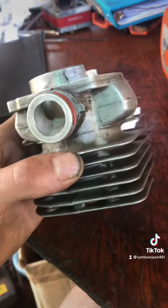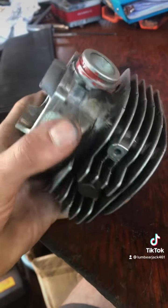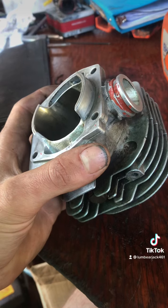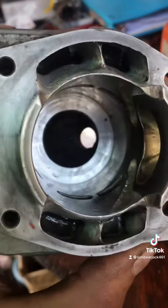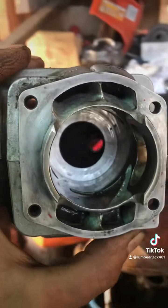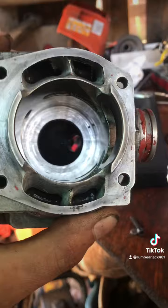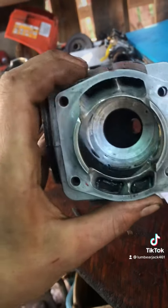Okay guys, here it is. My phone ran out of battery last time, so I don't know if I got all the footage. I ended up taking almost 55 thousandths, something like that, out of the squish band. I'd say that's pretty skookum. I ended up within a thousandth each spot, around 18 thousandths of squish all the way around.